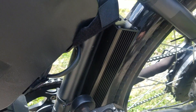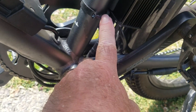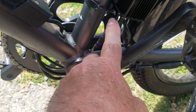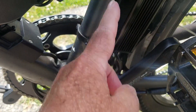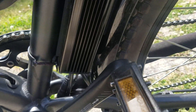Pretty easy installation — just use your existing brackets, get either 4mm or number 8 screws, 40mm length is good, 2 inches is a little long. Just use your brackets, clamp it back on. On the City, it will rub up against the rear fender — it's really tight on the rear fender.